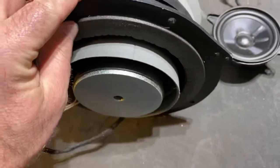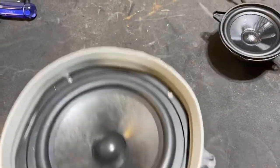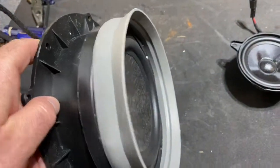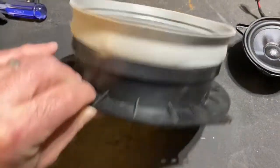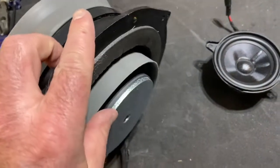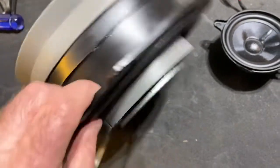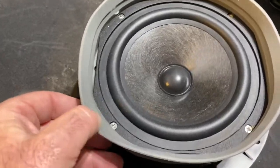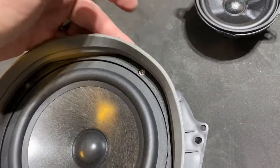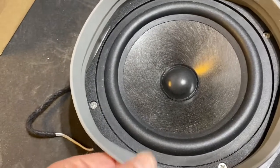So this is the woofer for the door. What you see here is everything all assembled. When you order it, it'll come with the silicone drip stopper, and then you'll get this mount with a spacer on there — that's just making sure you've got enough room for the full depth of the speaker. The speakers I ended up getting are the AC165, and they've got this weird kind of squared-off mounting ring, which doesn't really affect the performance at all.